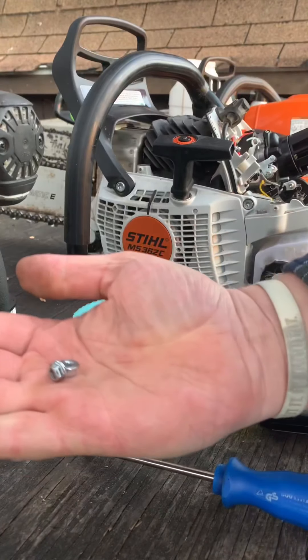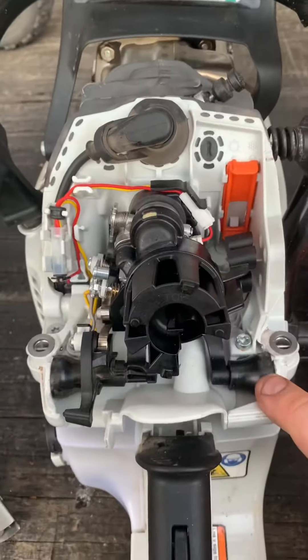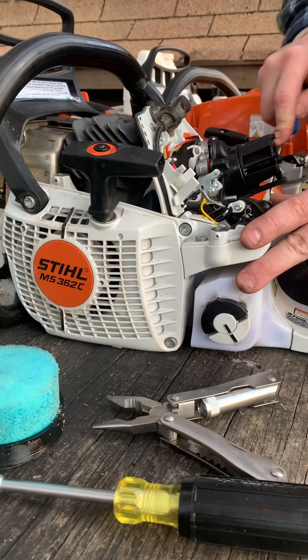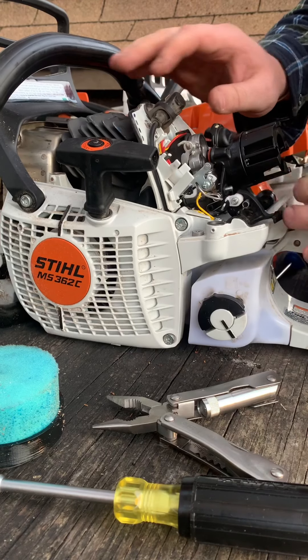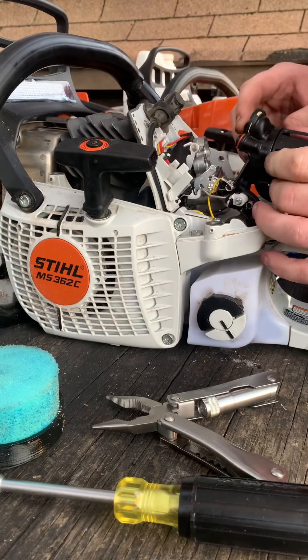Once you've got the two nuts off and put them on the bench, we're going to take this baffle off for this air filter to fit. You want to take this right-side rubber mount for the carburetor bracket and pop it off — just push it forward and kind of snake it out of there, then it'll come free off the carburetor studs. Push the carburetor back and slide this bracket off, keeping track of your wiring on this side.